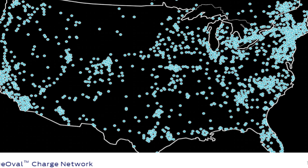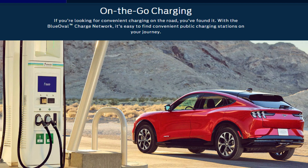Today we have Key-on Carter. Thank you so much for meeting with us. My first question: if I'm going on a long ride from Texas to Chicago, is it easy to replace the battery itself? No — your best route is to charge at superchargers or fast chargers along the way. Ford has an app where you put in your destination and it shows you which stops to make. The recommendation for going cross-country efficiently is to charge to 80 percent — that first 80 percent charges fairly quickly, about 30 minutes on a fast charger. After that, the last 20 percent takes an hour and a half. So charge to 80 percent, drive down to about 10-15 percent, stop and charge back to 80 percent — that way you're only waiting 30 minutes at each location instead of an hour and a half.